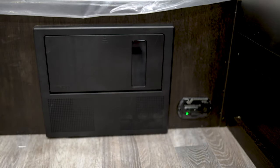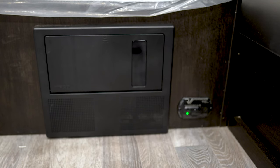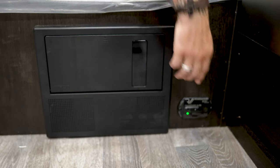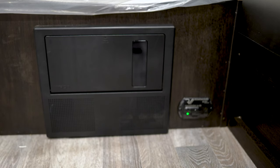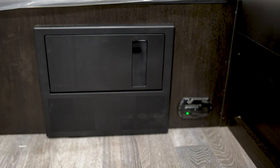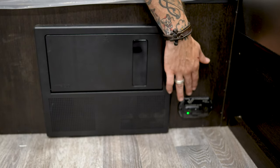Underneath the mattress we are going to find our carbon monoxide and LP leak detector. This is a very important piece of safety equipment, and as with all of our safety equipment, we do test that every single time we take the unit out. This unit has one button on it — that is going to be our test button. We go ahead and press that button and it lets you know that it is working properly with a series of light flashes and audible tones. This is wired into the 12-volt section of the camper, so there's no battery to maintain. If our batteries on the coach do get too low, this will start indicating to you that that is actually happening.